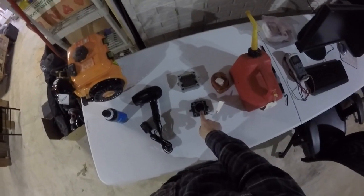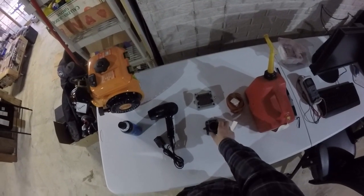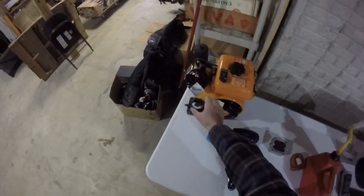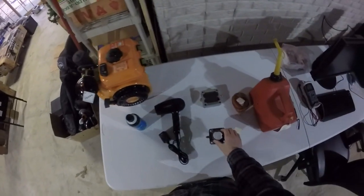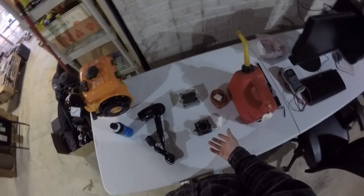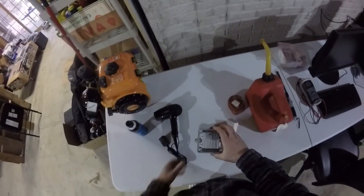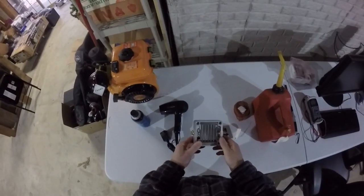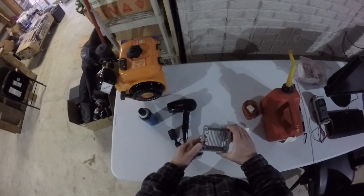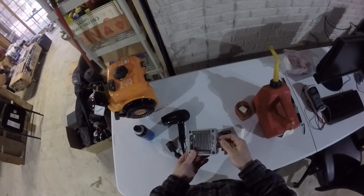This one came off of an air-cooled Yanmar one-cylinder diesel, so this would probably be your best bet for an engine this size, which you'd have to adapt to the intake and mount it in there. And then you'd also still have to have a 12 volt power supply, which could be inconvenient. This is a grid heater out of a Cummins engine, probably a 5.9. I'm not sure if the 6.7s use this same size. They may be bigger. I'm not that familiar with them.